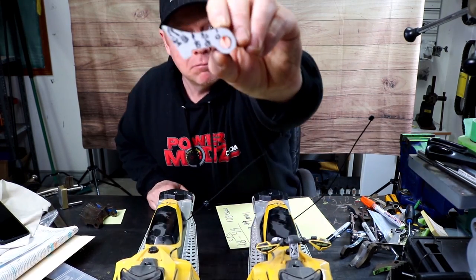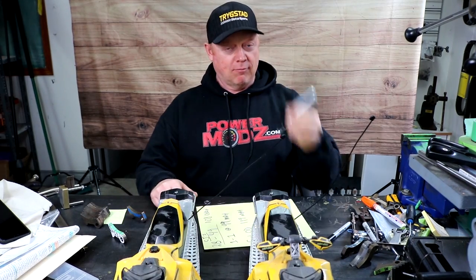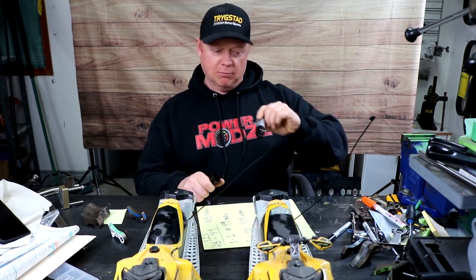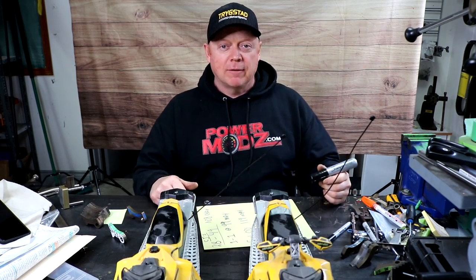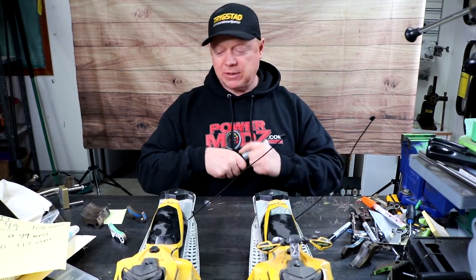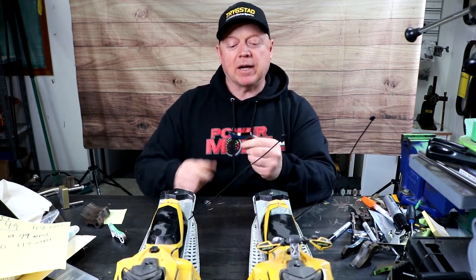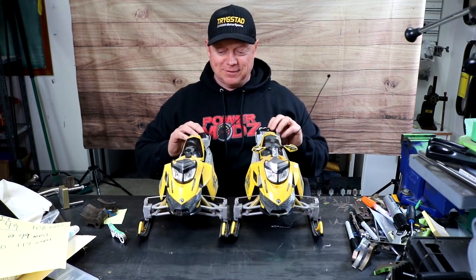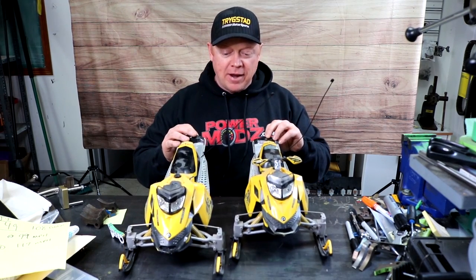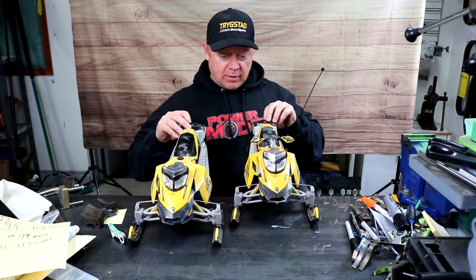Remember this ramp? So people take the felt marker and mark up the primary clutch, then do their run, and see where the felt marker got wiped off. What I wanted him to do is put a marker up his ramp like so, put the clutch back together. He comes off the start line like that, they're going down, and there's a point down the track where the guy starts reeling him in. Right there at that point - even, even, even, and then he reels him in.